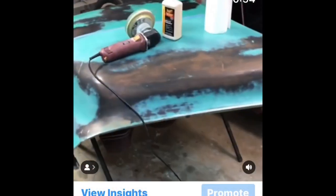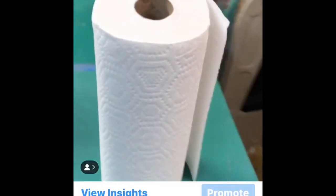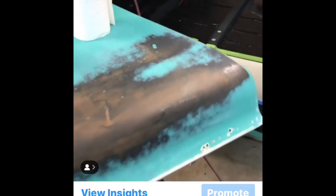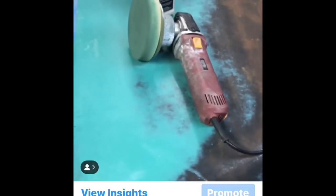We'll make this hood come to shine without putting any clear on it — how to get that patina to shine by using compound. On this 1955 Chevy pickup hood with original paint, I'm using a cutting compound product and household paper towel to wipe off the compound once applied. I started off with 800 grit wet sand to remove all impurities, followed by 1000 grit wet sand to get it nice and smooth to prepare it for the cutting compound.